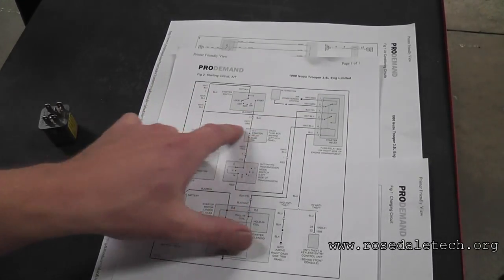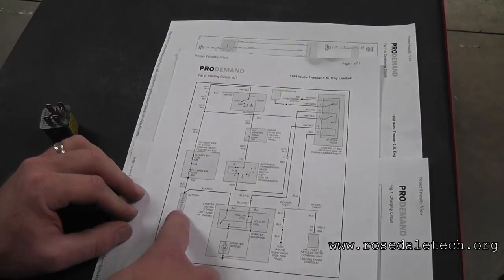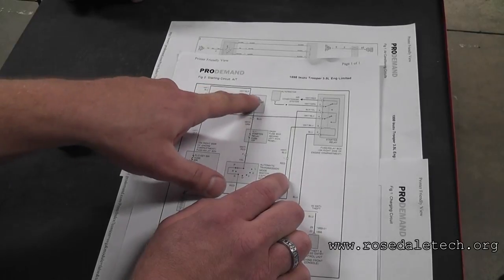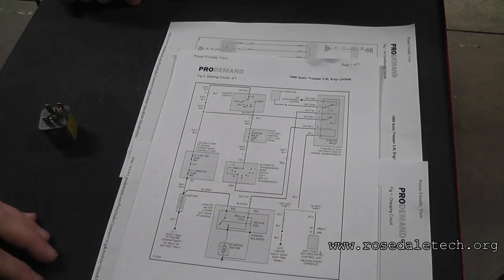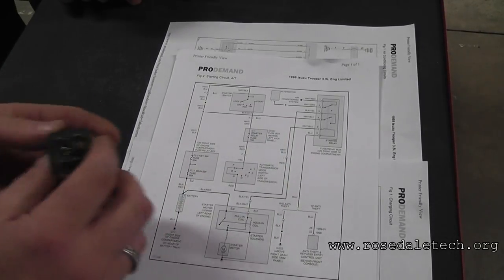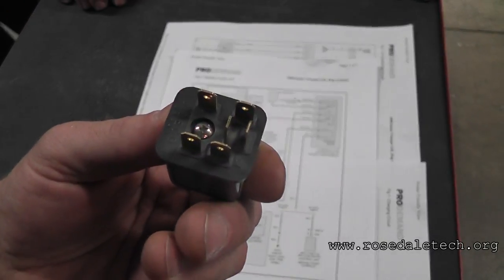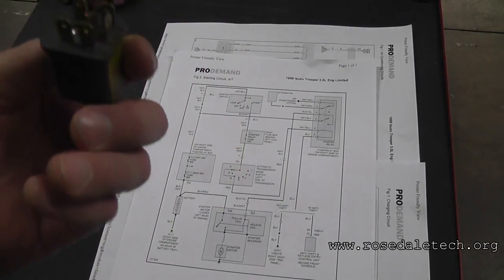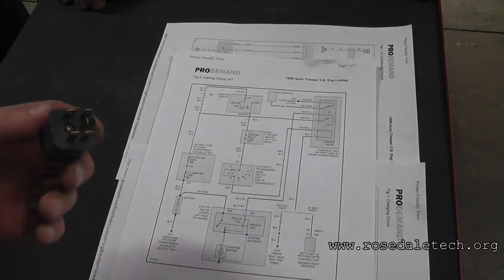Will we have some other feeds coming in here? This circuit — where does it go? Right to the battery. And the white-black, follow it — up here and down to the battery. So the white-black is going to be hot all the time. One should be hot all the time, one should be hot when cranking. I want those two identified. It's a goofy relay — I've never seen one like that. There's no picture on this thing. So one at a time, touch the female terminals in the connector and tell me what you got.